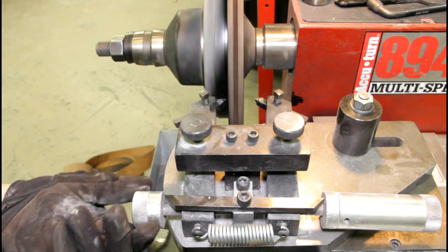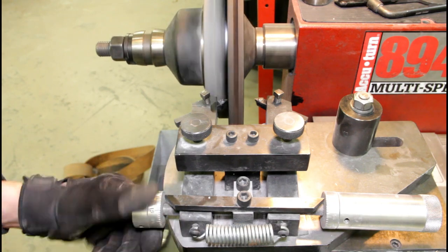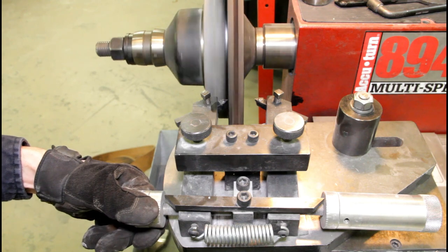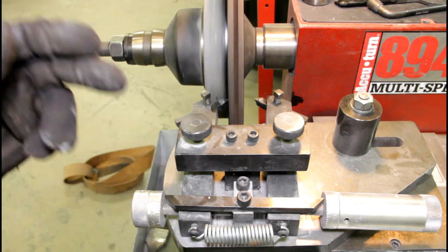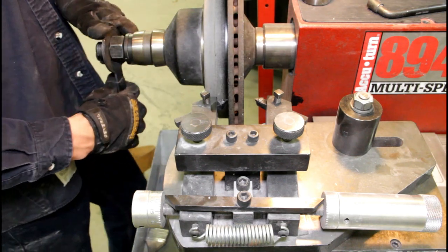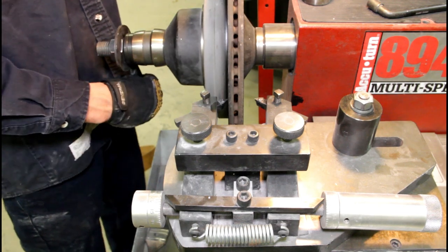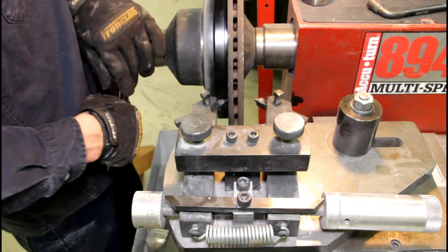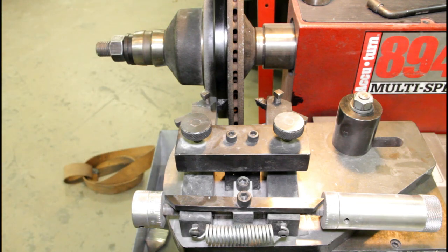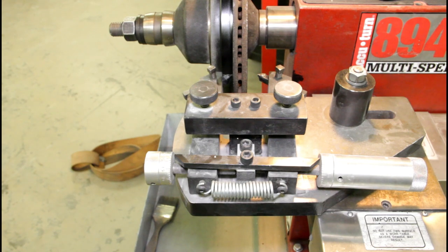The locks are loose. We're going to take what's called a scratch cut — just on the front side of the rotor. I'm going to rotate this micrometer — unlike the Pro-Cut, each dash is one thousandth of an inch — and bring it up on the front side just until it touches the rotor. I can see there's quite a bit of wobble. Now we're going to shut the lathe off, loosen the nut just a little bit, spin the rotor about 180 degrees, re-tighten, back the cutter head up a tiny bit, and repeat that scratch cut one more time.